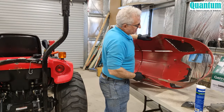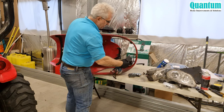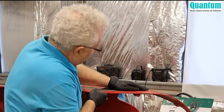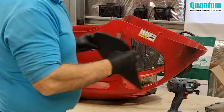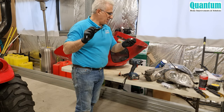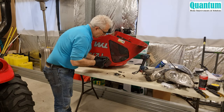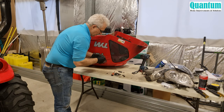I was able to take the bonnet off quite easily — basically just two 12mm screws, use a ring spanner and it came off. I'm going to take the remainder of the broken grill off and this section of the grill has also popped out — I'll pop it back in, and the other side too. I've taken the broken light section off. This section here is the TYM emblem, which I'll put back on the new grill. There's a little rubber on the back holding the emblem in place — I'll gently take that out and the emblem comes straight out.